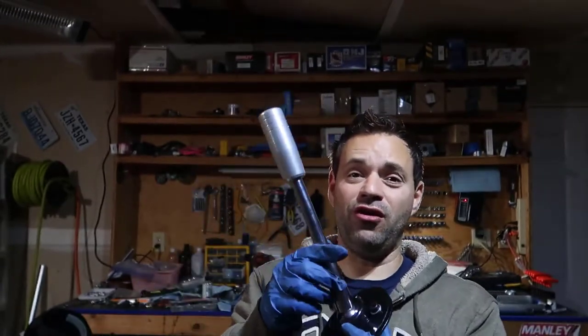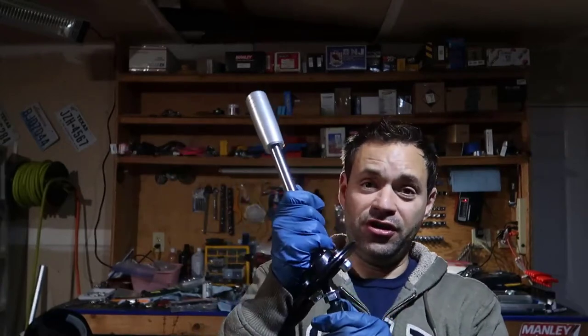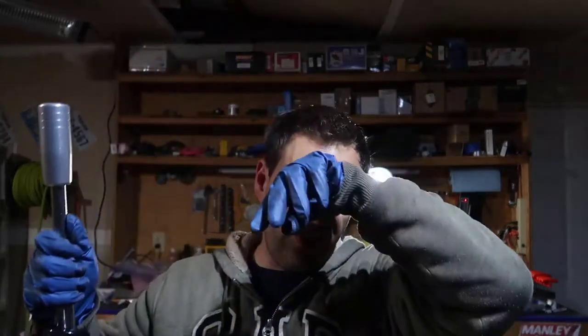What's up guys, today we are going to install the racing shifter. This is actually chassis mounted, so it doesn't have one of those parts. We're going to lift a clip, take the shifter out with the whole mount, and then mount this one on the bottom. Let's go into the car and I'll show you what I mean.